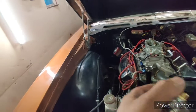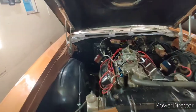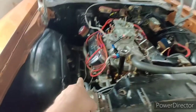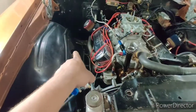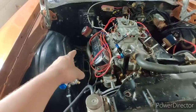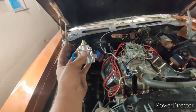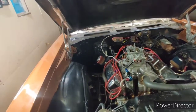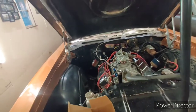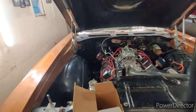I was going to go with individual lines, but I don't think there's any pros or cons to it, really. There's a fuel line right here — that's dash six. We're going to be going dash eight. There's already dash eight or half-inch line up to where this line terminates, which is at the bottom corner of the frame. I'm going to go dash eight into the regulator and then dash six to my fuel log, which should be good. According to everything I've been reading, dash six — three-eighths — is good up to 450. I don't think we're making 450.